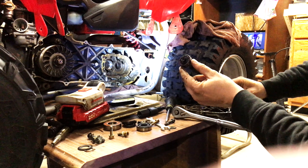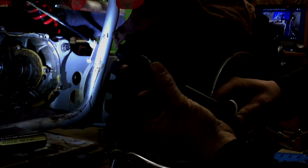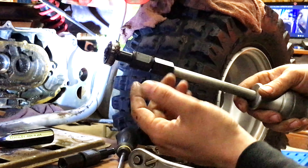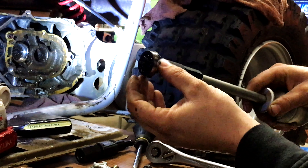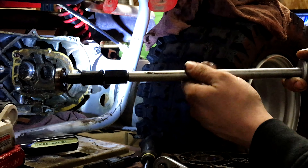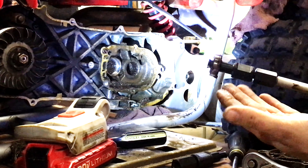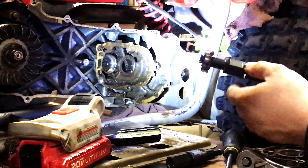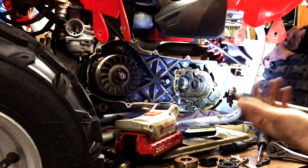Just like that — see how this works? You put it through the bearing and it expands, so you're able to grab the backside. These transmission drives stink so bad, but the tool grabbed the backside of that bearing and the slide hammer pulls it right out. Some guys use these for wheel bearings — they have a lot of uses, like engine cases. That's really what I had to borrow this tool for; I don't own it.